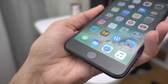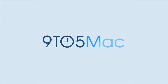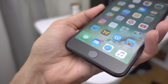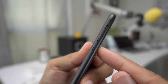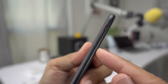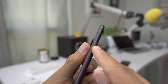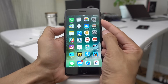How to force restart and get into recovery mode on an iPhone 7. The iPhone 7 has a capacitive solid-state home button that won't function properly until iOS is booted. So to force restart and get into recovery mode, you're going to have to use the volume down button in combination with the traditional sleep/wake button. The home button is no longer part of the equation.